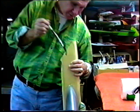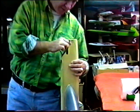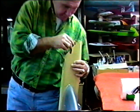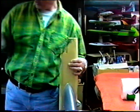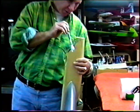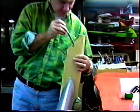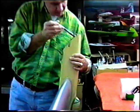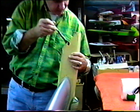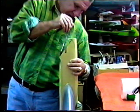So what I do is I hold it down, and this is really a good trick too, no matter what design you have, and let everything flow down to the bottom. Then I'll take this over by the hook. Get plenty in there. Take it over by the hook, or just hold it upside down and let whatever extra runs out, run out. Get up in here, up by the blind nuts, the doublers, all this stuff. Down in by the air vents.